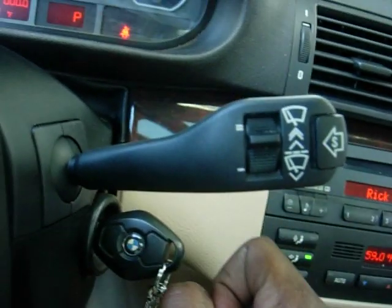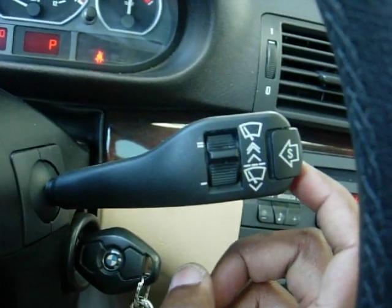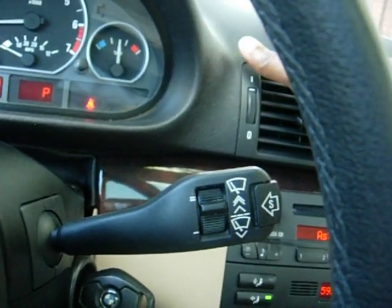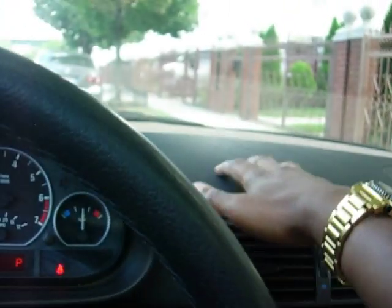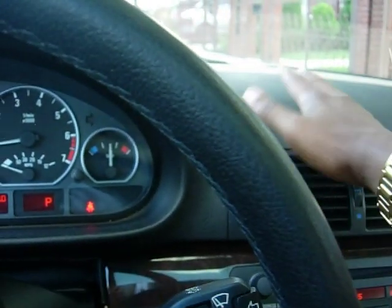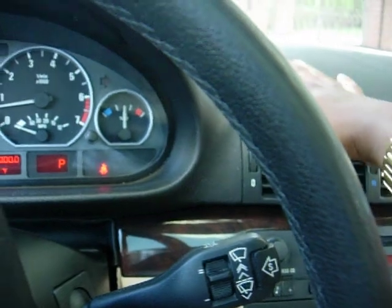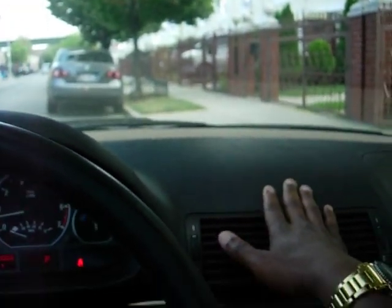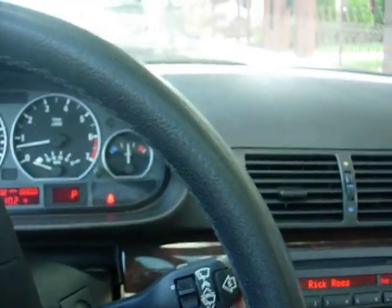What the S-button does is: when you set the rain sensor to come on automatically, you push S in once. And what S does is at every 5 or 10 minute intervals, while your windshield wipers are going — either in a rainstorm or driving on a dirty road where the windshield detects fluid — it will wash your windshield.